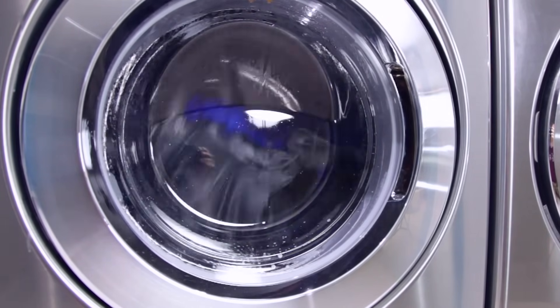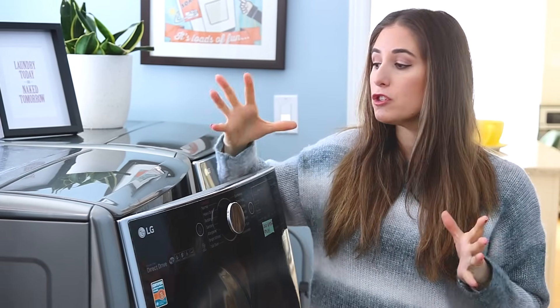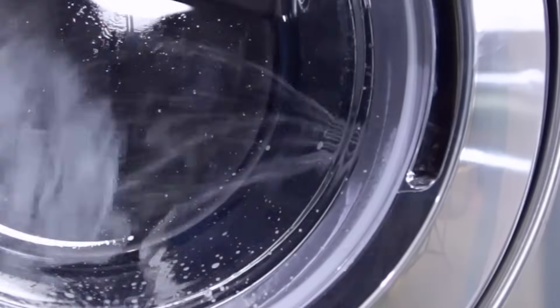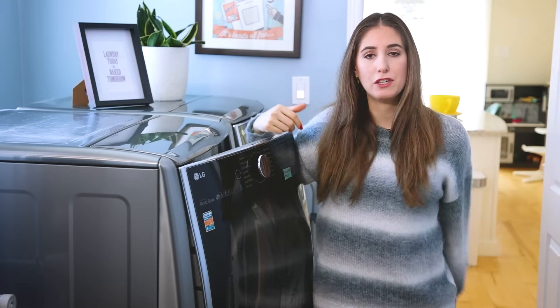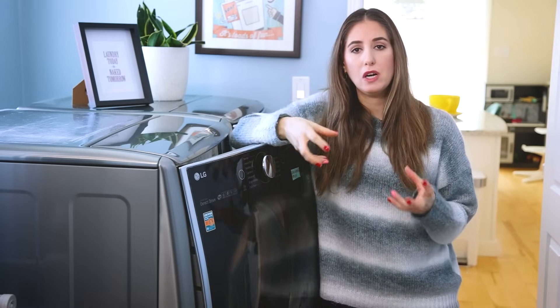You'll notice that your machine spins a few times — the drum spins a few times. That is load sensing, weight sensing. Your machine is figuring out how heavy the load is and how much water it needs. What happens next is water starts to run based on the selected program you've chosen. The first place that water runs is right here in the detergent, so it infuses water with the detergent and starts getting it into the drum. Then the machine fills with the appropriate amount of water mixed with detergent, and then the mechanical action kicks in where those paddles inside the drum start to flip around and churn your garments.